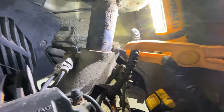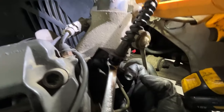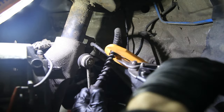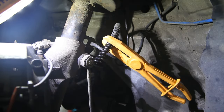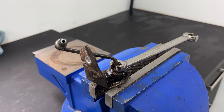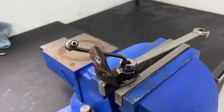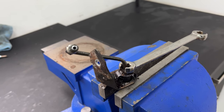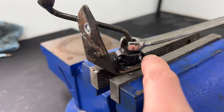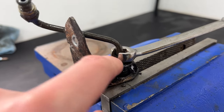So what I'm going to do is clamp off the hose, cut it here since I'm replacing it anyway, undo the one bolt holding this bracket and put it in the bench vise. The reason I'm bothering to undo this is because I want to reuse the bracket. Even with a flare spanner, the force I'm putting on it is just rounding the nut. So I'm going to bend the bracket out and slide the whole brake line out, then buy some new retaining clips.